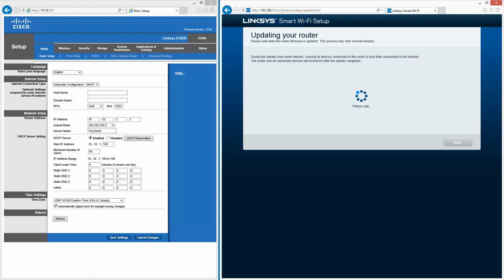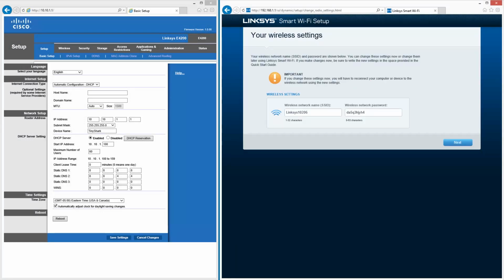Not really a surprise. I'm looking at the LED light that backlights the Linksys logo on the device itself, and it's flashing slowly right now. That means it's busy doing a reboot or something. Either way, whenever you see that on this particular brand of router, it means you're not surfing the web because it's busy doing something else, maybe applying some settings you may have changed, or in this case, updating its firmware. Okay, you missed nothing. I just sped up time there for a 2-minute segment.